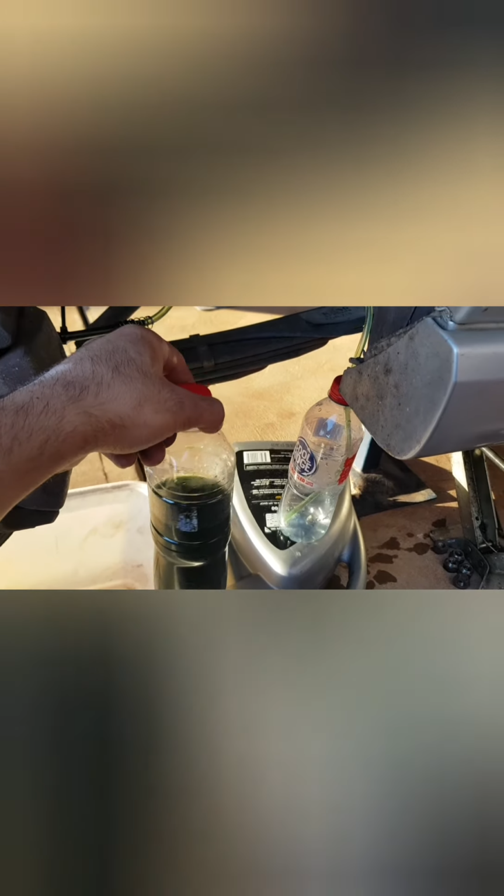Thanks, guys. Now if you're like me and this is your first time flushing brake fluid and you're a little unsure whether the brake fluid coming out is completely fresh or not, I've swapped over to a completely clean bottle. Let's press the brake one more time and see if we're happy with the color that's coming out here. We can perhaps match that to brand new fluid. I still feel there's some green tinge in here, so I will go a little more, but I thought perhaps this tactic may help those of us who are a little less experienced decide if things are going well.